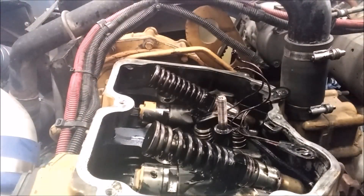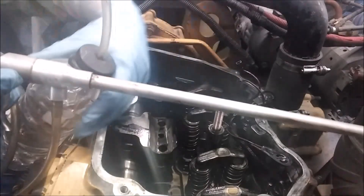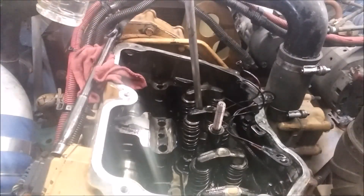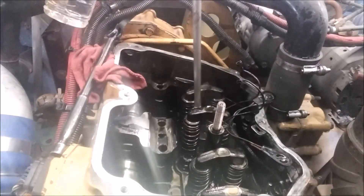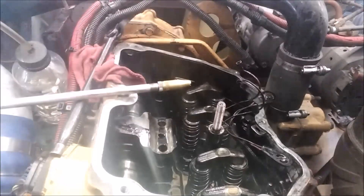So the injectors are pulled out. Now you're going to have to clean the injector bores. I use a solvent spray with brake wash. Here's the injector bore looking down through it — what you're going to look for is any O-ring material or thick carbon buildup. There's always going to be carbon on the bottom, and that's what you're going to have to clean out. I just spray them out with this brake wash setup, and that works pretty well. I used to use a wire brush, however, I've had the wire bristles come off and sit in the injector bore, and you don't want that — any metal getting in that cylinder because your combustion chamber is just below the injector bore.